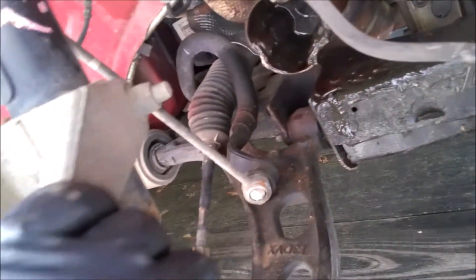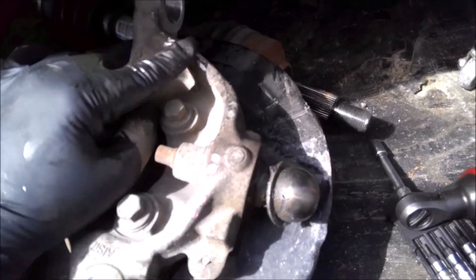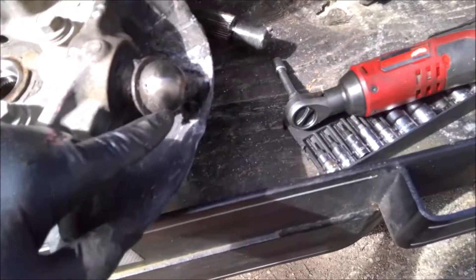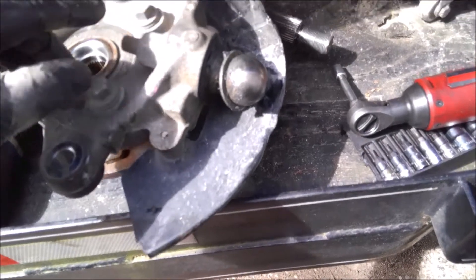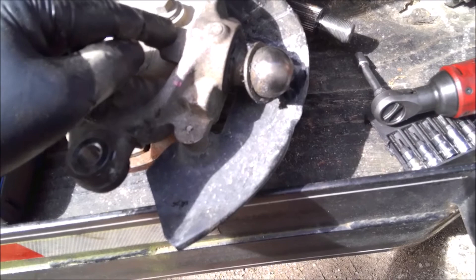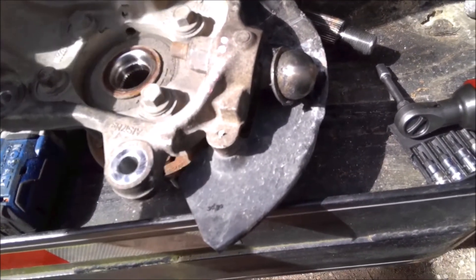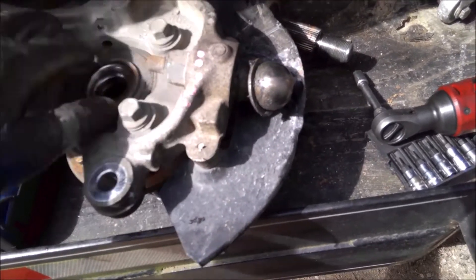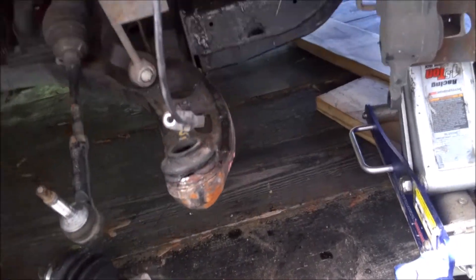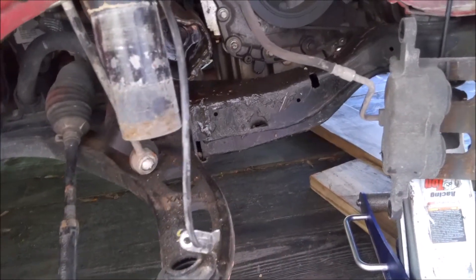I got this out. There's a couple of little scratches on this aluminum but I don't see any cracks. I think the ball joint took the brunt of this impact. I'll look it over real good to make sure there are no cracks or anything, but this appears to still be in pretty good shape. We're down to the lower control arm and the strut.